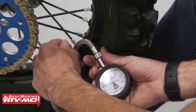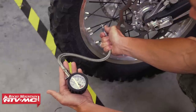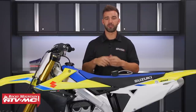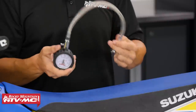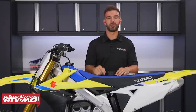A good rule of thumb is that for every 10-degree rise or drop in temperature, that's about a pound of PSI in your tire. Right before your ride and throughout the day, check your PSI to keep it consistent. Too low and you can damage your rims and get pinch flats more easily; too much PSI and your tires will deflect and you'll sacrifice traction. When it comes to tire pressure gauges, Motion Pro makes a really nice digital one, and I've also been using the Tusk Pro Caliber gauge — inexpensive and always worked well for me.